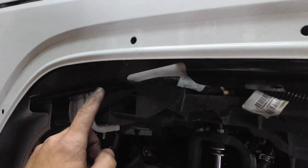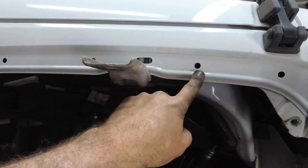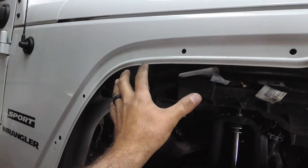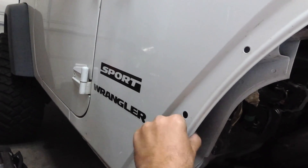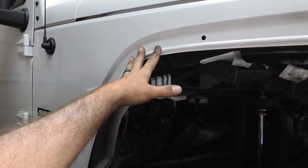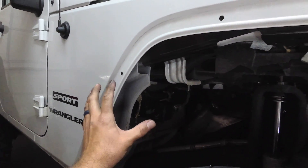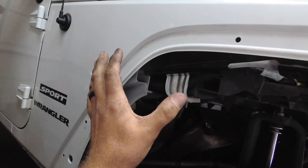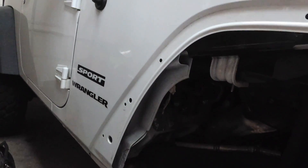You have brackets that go up inside behind the fender. We've got this one in place and we're going to place the bolts in here — this is going to be the backing to hold the fender on. This isn't just a fender that bolts on the body; it's really thin sheet metal. The difference between these fenders and cheaper ones you can buy online is they've got these plates that make this fender a lot more rugged. If you lay over on your side or hit a rock, it's actually going to keep everything in place and not bend and bow the body of your Jeep.